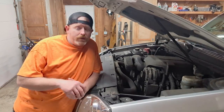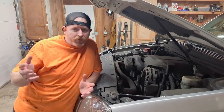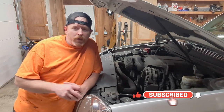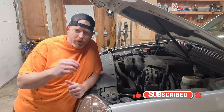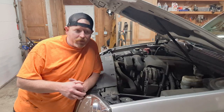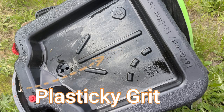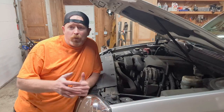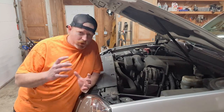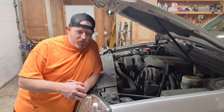You need to get that system looked at or replaced if it's got 200,000 to 220,000 miles on it. The parts are made out of plastic — they break down and wear out. I knew this one needed replacing because about a week ago I changed the oil and saw some little plastic gritty stuff in it. You'll also start getting check engine light codes like P0011, which is a cam phaser code where the system can no longer control where the camshaft sits — it might say advanced or retarded — and you'll start lacking in fuel economy.